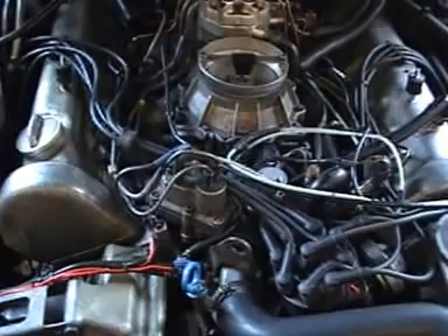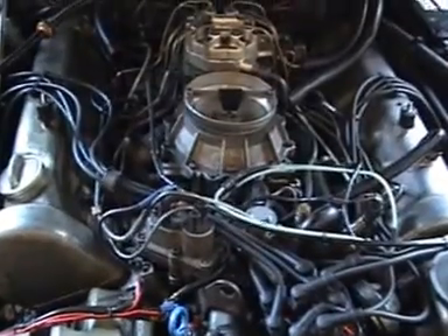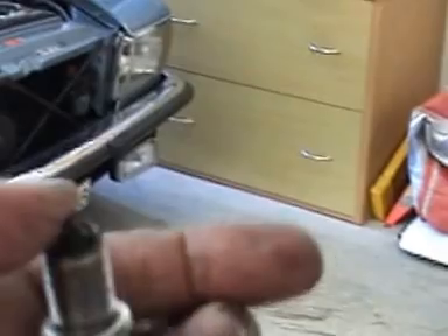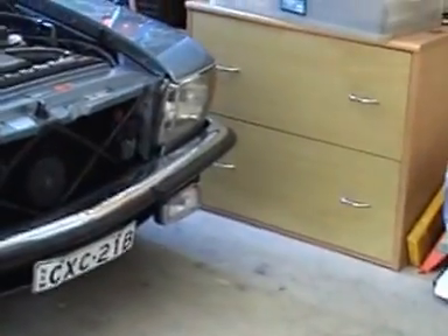What a difference a warm-up regulator makes. The guy who said they should really call it the fuel pressure regulator is 100% correct — the car just doesn't run if it's not running. We still have a slight miss. I finally found what the slight miss was — it's a spark plug. The spark plug down here was bridged out with carbon deposits. These plugs have only been in the car for a year. I scraped the carbon deposits off, but it was bridging out across the gap. When I looked up the guide it said to just clean the spark plug — it had just filled up with carbon deposit, so it must be a common occurrence.